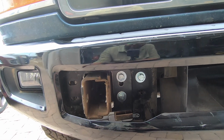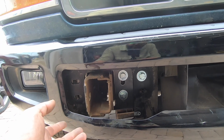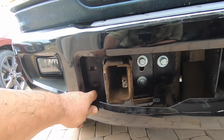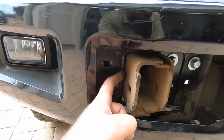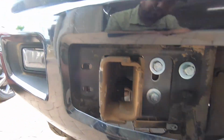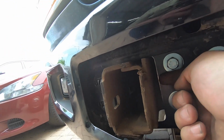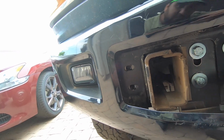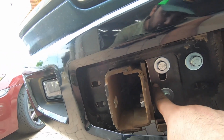I am gonna come back and like I said, once I find some tow hooks, I'm gonna come back, cut the frame. Basically how you have to cut it is basically flush with my bracket. So this right here is my bracket. Basically cut it flush right there, or a little bit more this way. Just like I said, leave the weld on the back of this bracket on.